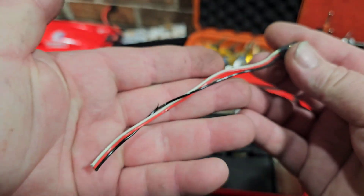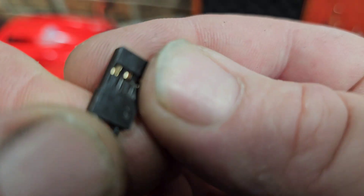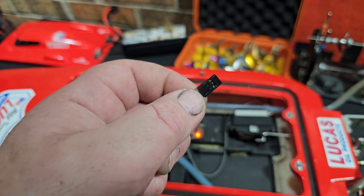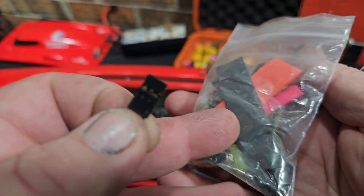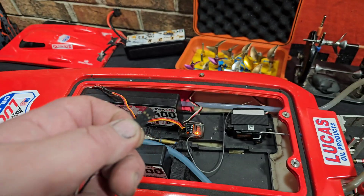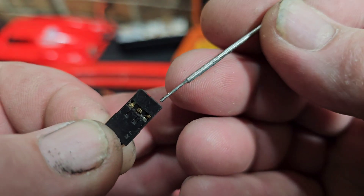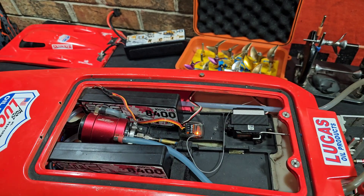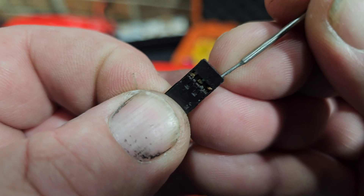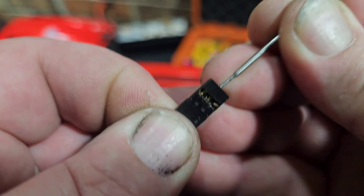So this is the connector. I cut it off and actually re-soldered a new wire on — I got it fixed. But I looked at my connector and it looked like it had some corrosion on it. I was kind of pulling it in and out, messing with it. In my toolbox that I take with me to the pond, I keep this little bag — it's got heat shrinks, little tubes, brass tubes, soldering wire, just a bunch of miscellaneous odds and ends. I pulled out one of my wires — I keep this right here just for this — because with RC boats, a lot of times you get water in the boat. I run in salt water, and salt water on these JSTs will corrode them. So I was sticking this wire into each prong, back and forth, just knocking off some of the corrosion.